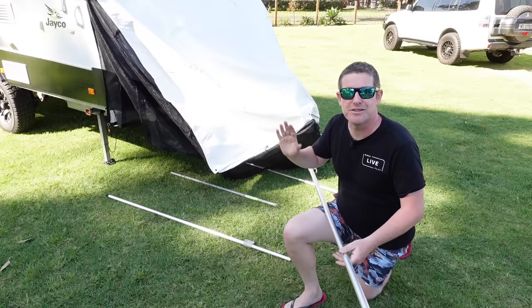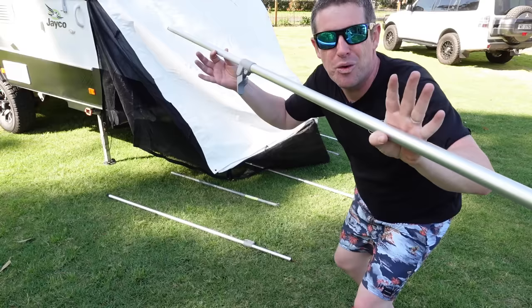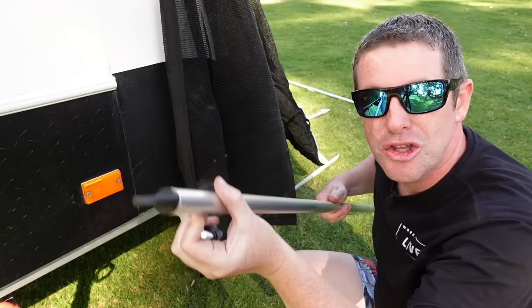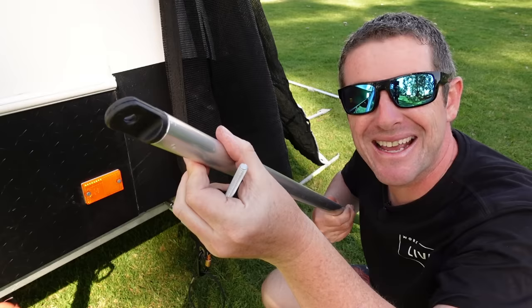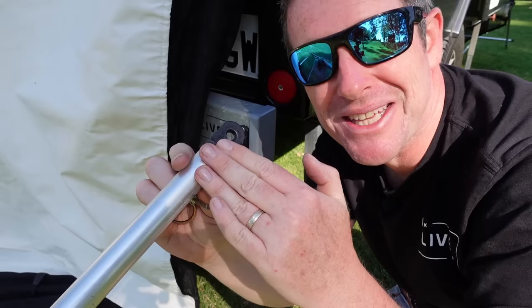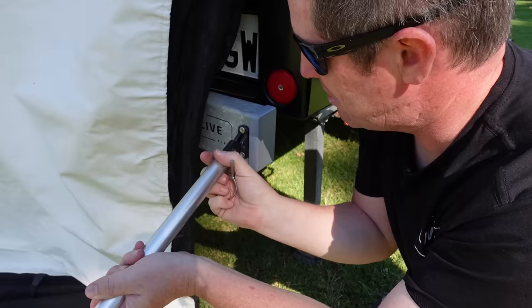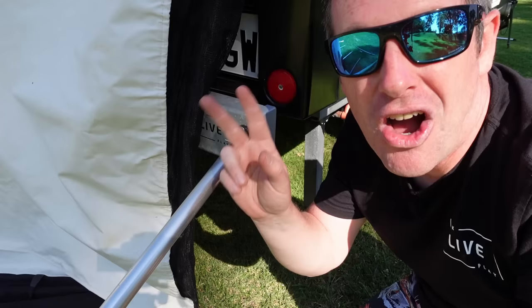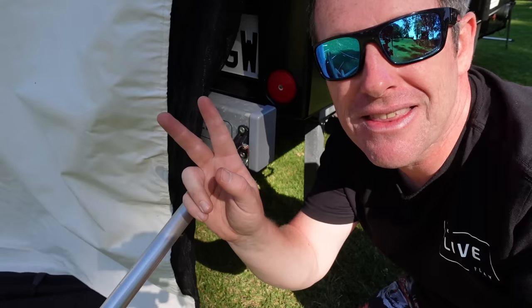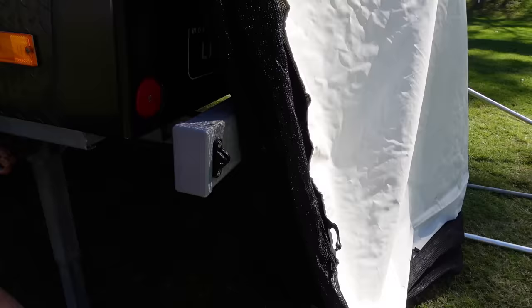There's a spreader bar that goes from side to side of the camper. Pull it out so it's roughly the width of the camper — that way you're not trying to do it while reaching and trying to hold everything down. You also want to attach the poles onto the side of the camper so they're ready to go, including the rear poles. We have a slightly different setup to the Caravan Mods system as ours was done before that — we don't use the bird peaks, we simply have the same setup as the front with a pin that goes through and locks it all together. I've made two videos on these fly mods which I'll include in the link below, also in a playlist this video is part of.